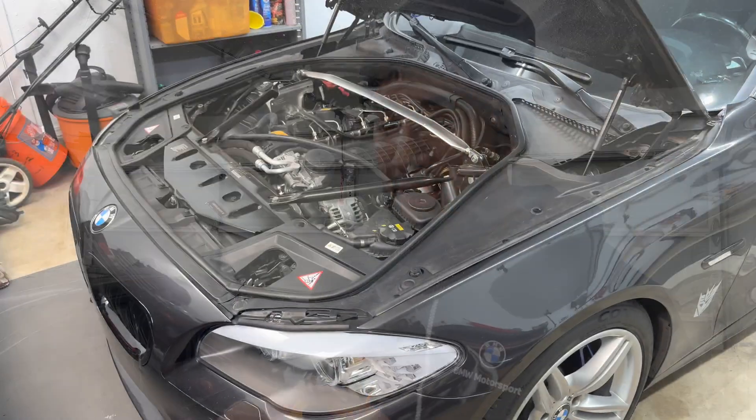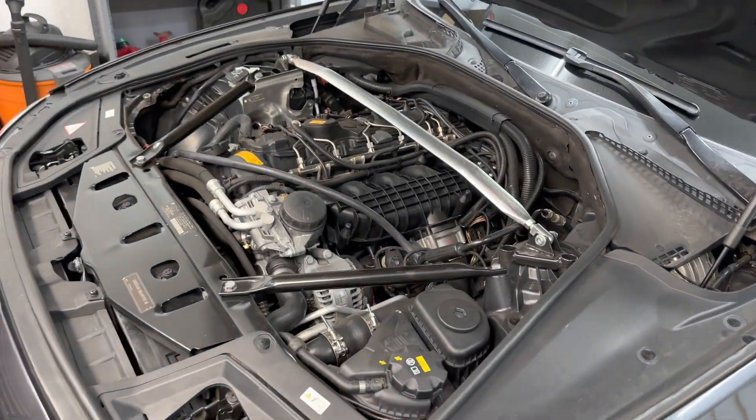That additional range allows the tuner to tune beyond what the factory sensor can read. You can go ahead and install this on the stock turbo, but it's not going to give you any more power — it's really just throwing money out the window. The only people that actually need this are people putting a bigger turbo on their car. I'm doing that in the next few months — I already have the turbo sitting in my closet, but it's just very cold right now.